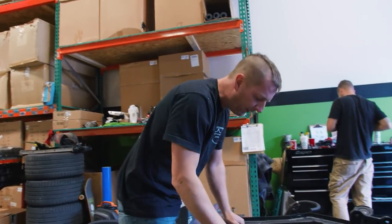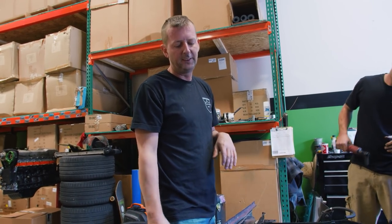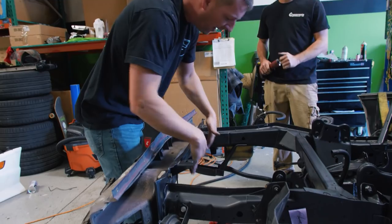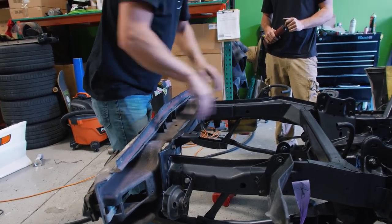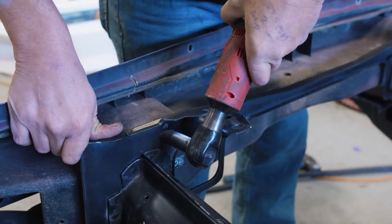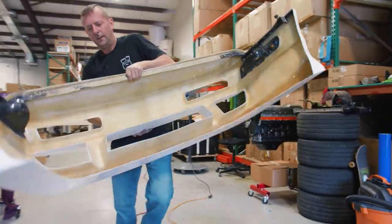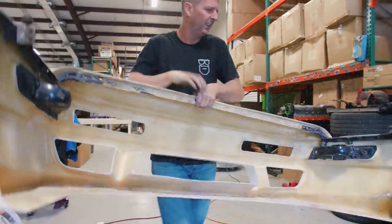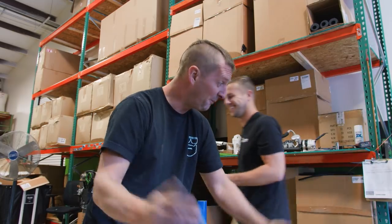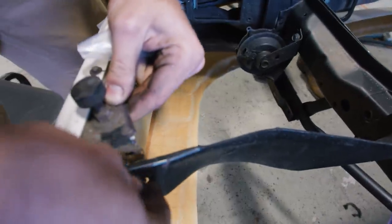I just cut out the front support and made room for our shrouding, then cut the front bumper to allow more room for the shroud. As it was, there was only this much room for the ducting to go up through it, and I wanted to give it as much volume as possible. I cut it out so it can come up higher and go to the intercooler and radiator. The bumper only takes four bolts to hold on — better than two zip ties.